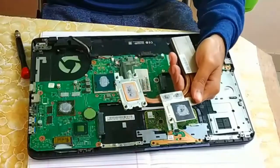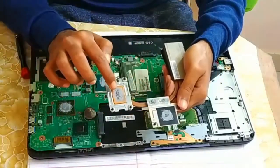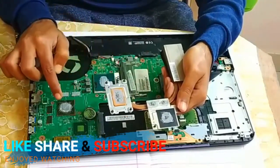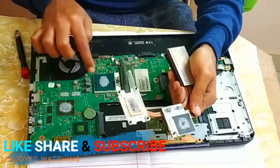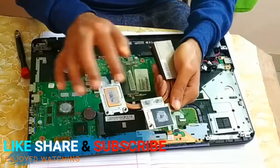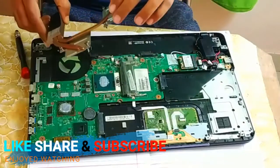So guys, this is how easily you can arrange the heatsink paste on this particular area. It should be in the center so that you can cover the processor area and the GPU area. Got it? And make sure you do not touch your screwdriver to these particular sections, or else it may get damaged.